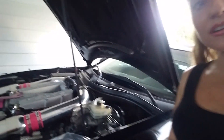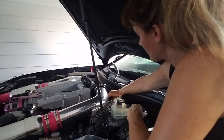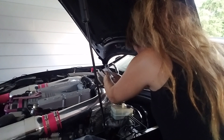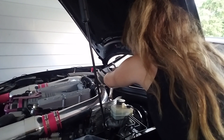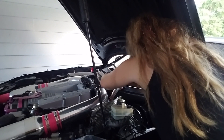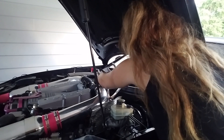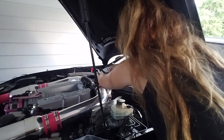You can see over here the fuel line attaches back here to the car. You need a 17mm wrench and a 14mm wrench, and there are two nuts that need to get tightened together. You're going to put the 14mm in the back, 17mm in the front, and you're just going to tighten these two together and make sure it's nice and snug.